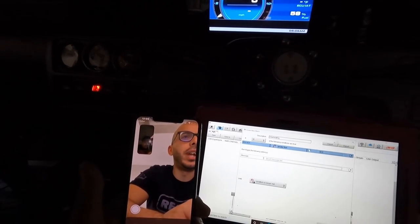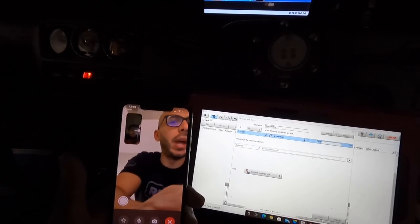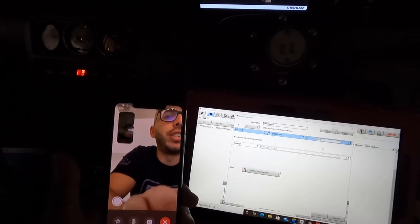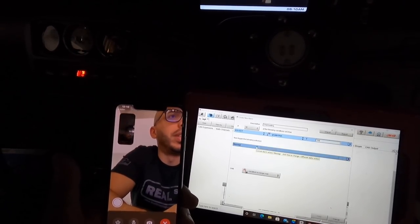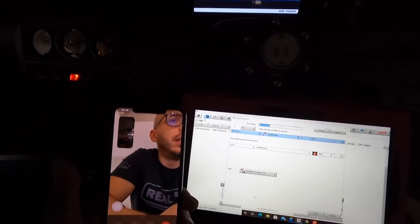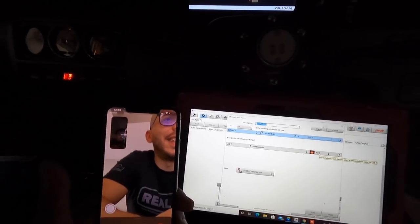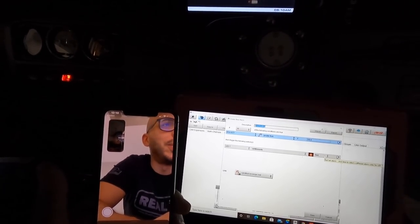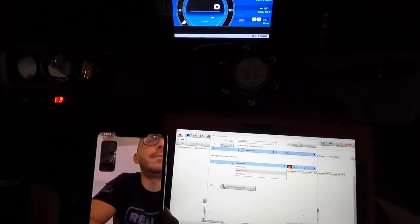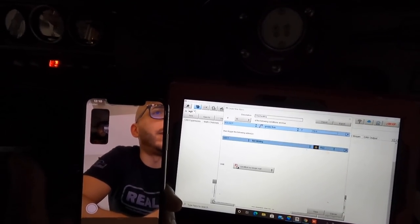So what we're doing is we're gonna create a command for engine overheating. Right now, realistically, we want it at 110 just to test it, because the car's in the garage right now, but we'll put it to the right temperature. Anything over 190, I'm pulling over. Nah, that's nothing. My Integra will go like 220. Nope, not 190. And overheating for me. And we're gonna make this a fast blinking one so you do not miss it while you're driving.